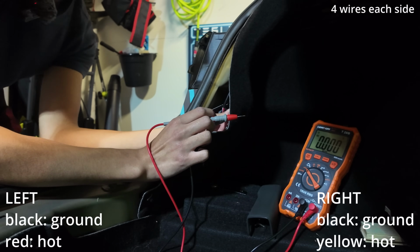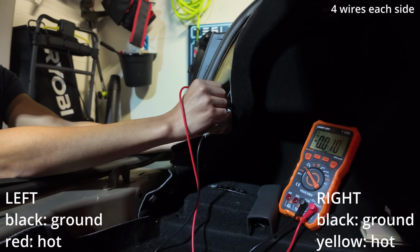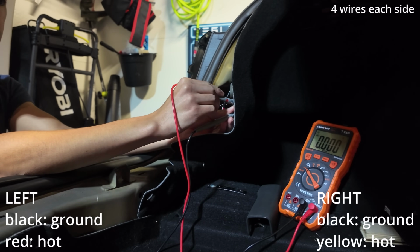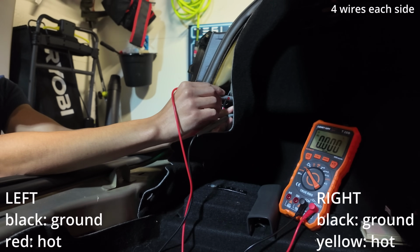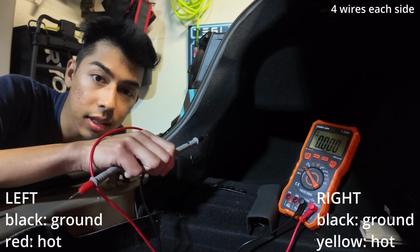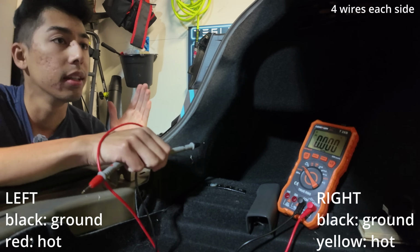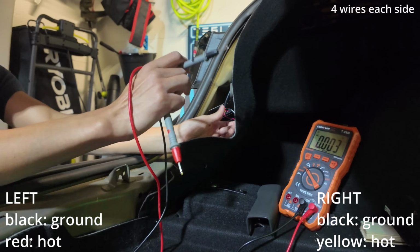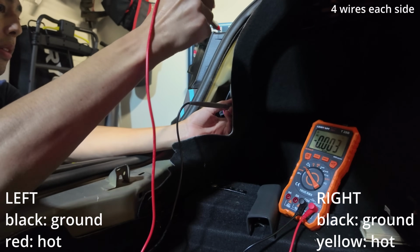Or I'm sorry, hit cancel turn signal, hit the hazard so they both sides flash. No power in the middle one. No power on either. Weird. Interesting. Okay, cancel turn signals. Or cancel hazards and press your foot on the brake again, sorry. Okay, so what's interesting is they're both getting power. All right, let's foot off the brake and turn on only the left turn signal. So the one closest to the house.